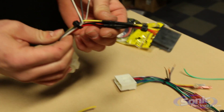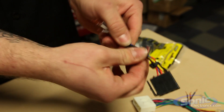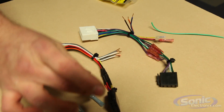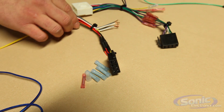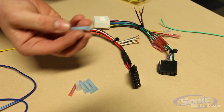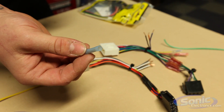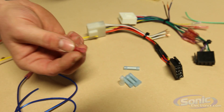Then we have our solder and heat shrink. Now, granted, I only did about five wires here, but you could tell the major difference in how much less thick the actual harness is, so it's going to make it much easier for you to get it back into the dash. Other connectors that could also be utilized — we got our crimp caps already covered, we got our 18 to 22 gauge butt connector, but you also have a different size butt connector: the 14 to 16 gauge, which is obviously used in the larger wire applications. Say if you're joining two grounds together, you probably want to use the 14 to 16 gauge butt connector, which are typically blue. 18 to 22 gauge are pink, which you use all day in car stereo installations.